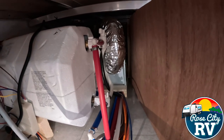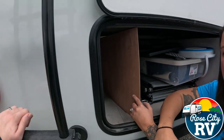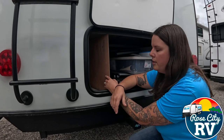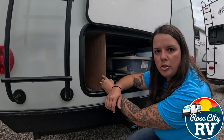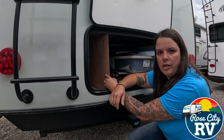In use mode, those will be turned back towards the water heater, and that means that the water — or in this case the antifreeze — is going into the water heater, and obviously we do not want that. So we've got those valves turned and we are now ready to start driving antifreeze through our water lines so that we can winterize.